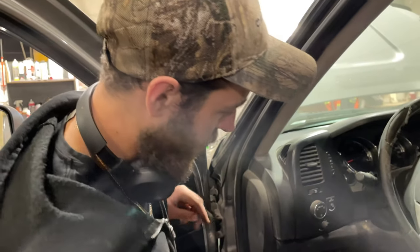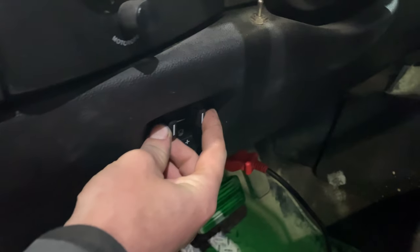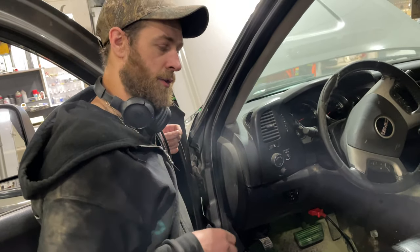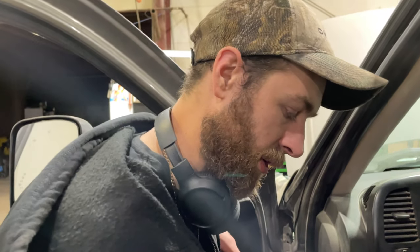Just like most systems, you've got this panel here where you can adjust your gain, and there's also a manual lever to apply or release the trailer brake control. On the plug in the back, the two bottom pins — one is ground and the other is your power output that goes to your trailer — applies the brakes more or less depending on how much brake pressure you have.